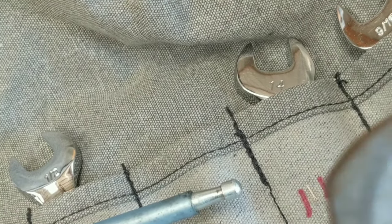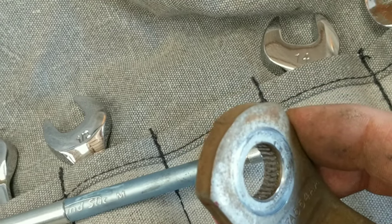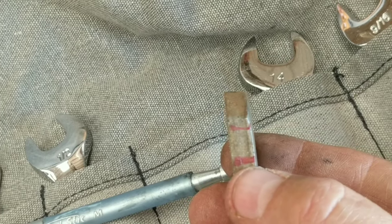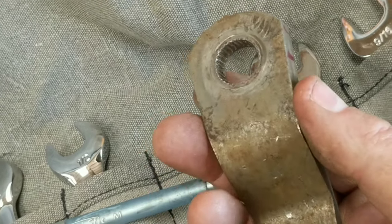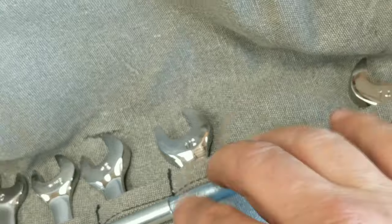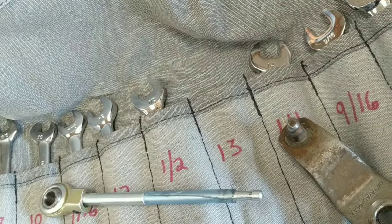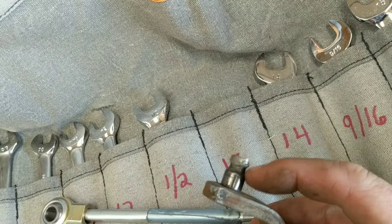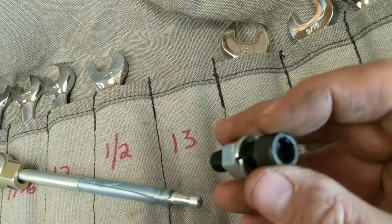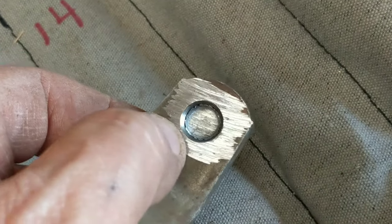This swing arm is splined. When it's on the clutch pedal, there's a rod underneath there — if you're doing this job, you'll see it and it'll all make sense. That's also why I put index marks on here, so I can put this swing arm back in the original position if for some reason this does not work. Once I get this pin taken out, this new bolt goes in its place. It's a tight fit — you don't want to drill this out. Grind off the end and drive that pin out with a hammer and a punch.